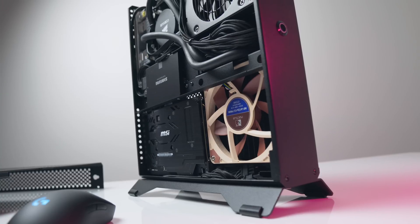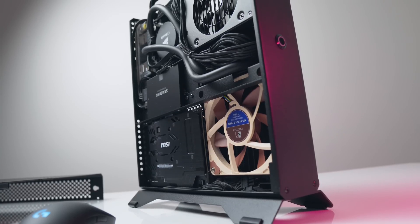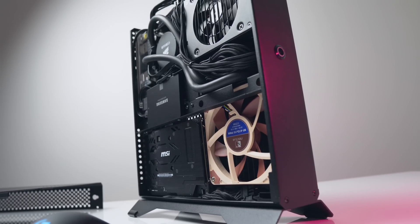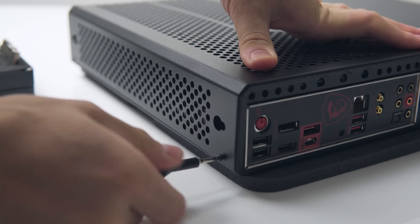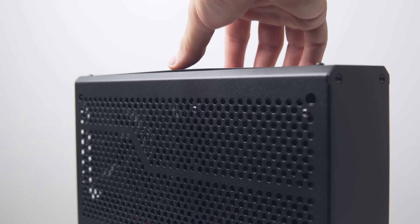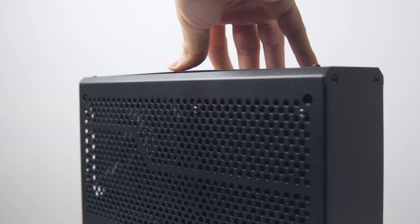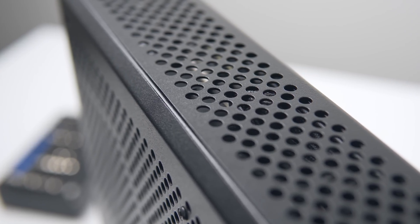Overall it's an incredibly tightly packed system with barely any room to move. The mini graphics card is basically touching the radiator, the power supply cables need to be squashed together, and getting the side panel on does require a bit of force. The only issue I ran into was with the power cables on the graphics card — I'd recommend using stock power supply cables rather than sleeved ones, as you'll be able to bend them easier and avoid a bulge in the top panel.